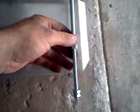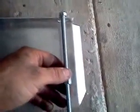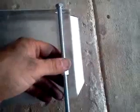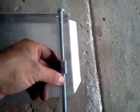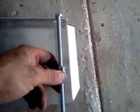Now this is a 12A motor, so I'm assuming that the 13B would probably be the same. I haven't tried it, but you have the concept now that you can do to mount this heat shield onto your block to cover the header heat from getting to your intake manifold.